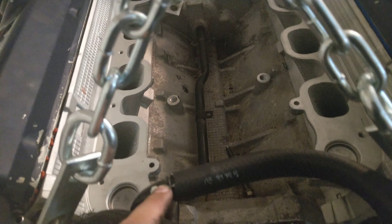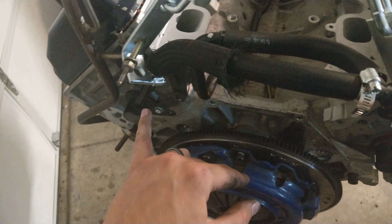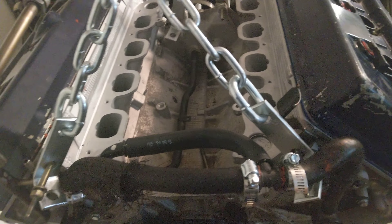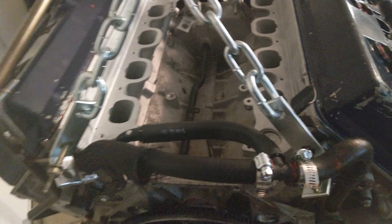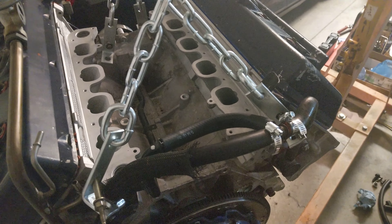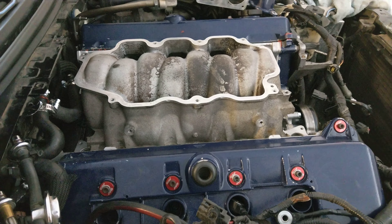You want to put the heater hose mounting over top of it so it sort of seals. Install this heater hose, put the bolt in, and then you just have to run your lines. What I did was get some five-eighths heater hose — that's the size it is — and a five-eighths T. Ran that little curve up, did a T right here, a couple hose clamps, and a bunch of RTV.